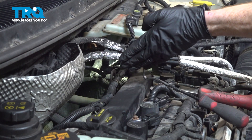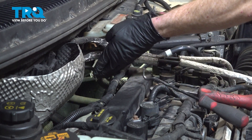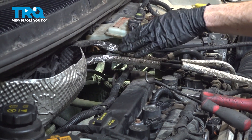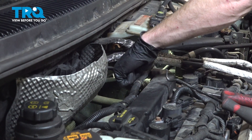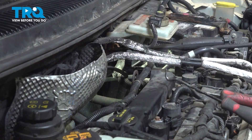To get started on our downstream O2 sensor, we're going to start by making our way down along the back side of the engine. It's important to note the O2 sensor is connected to your exhaust. The connector itself is right down along this area, which is also right next to your exhaust manifold, which can be very hot. Make sure it's cool to the touch before you continue.